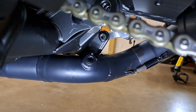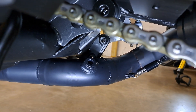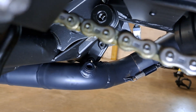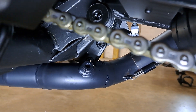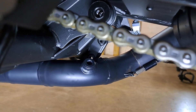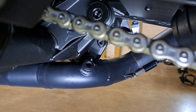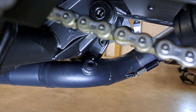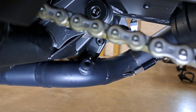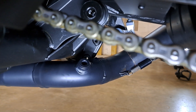Another cool thing about the Brock's exhaust is that it does come with an O2 block-off. However, if you want to remove that to run an O2 sensor, or if you need to run a wideband for data logging or whatnot, you've got a great place to plug that sensor in. Real clean exhaust air will give you a very accurate reading for wideband, if you need it for data logging. Good job, Brock's.